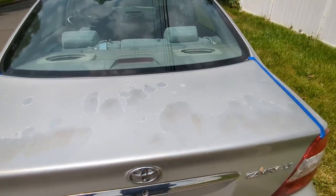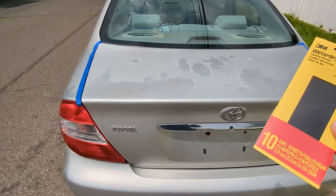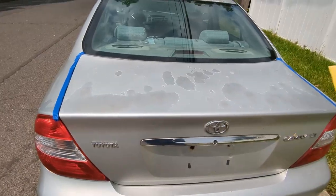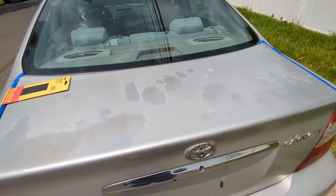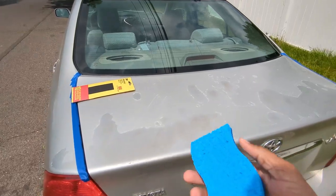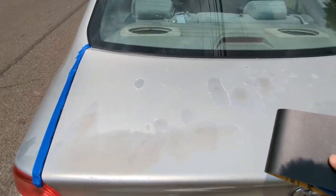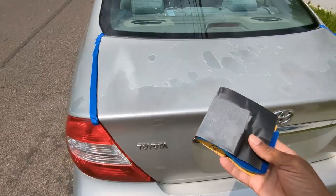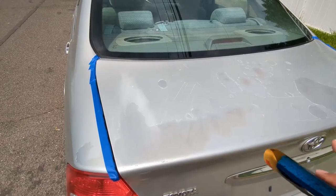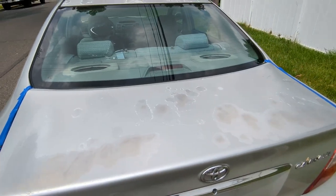To sand it down, you're generally going to use 600 to 800 grit sandpaper — I'm using 800 here, but either is fine. This should take off the top layer of paint without stripping it all the way down to bare metal like 100 grit would. We're also wrapping the sandpaper around a sponge to make it easier to hold. We're going to do a dry sand, not a wet sand, because you want more abrasion. Get it to a nice soft, even texture where everything feels smooth and uniform.